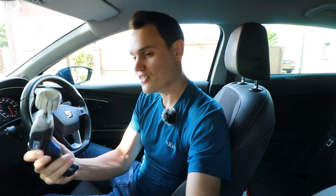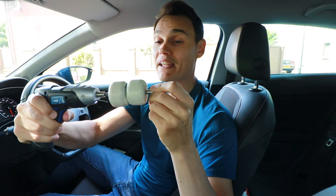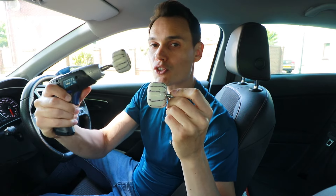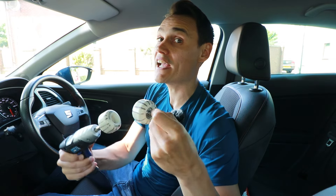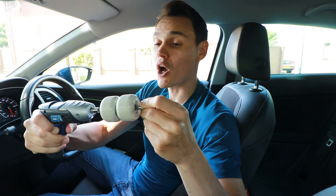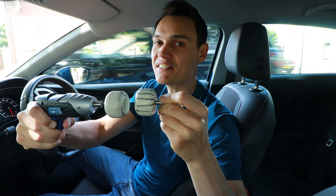This represents your engine and this skateboard wheel represents your clutch. When your clutch is up, they're connected and they spin as one. When you push the clutch down, you separate them. The trouble is, if you push the clutch down slowly, you don't separate them cleanly — there can be a slippage stage where they actually reconnect and cause a jolt through the car.